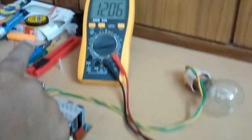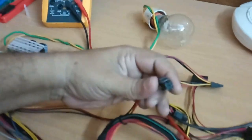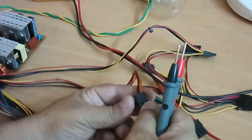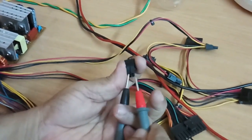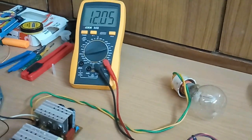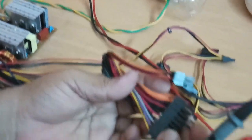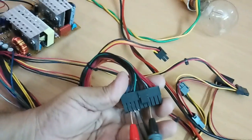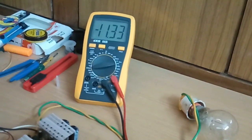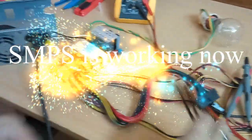The 12 volt output is shown. The red wire is showing 5 volts. And here, 3 volts. And 12 volts. And 5 volts. Minus 12 volt is also shown in the output. This is the way we confirm that the power supply is working.